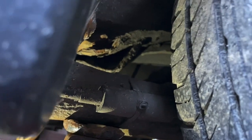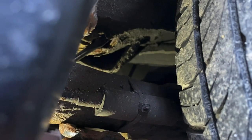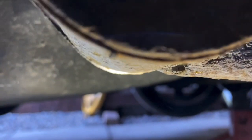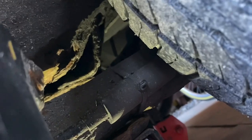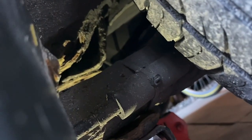And also I found — where I'm pointing with the screwdriver here — that bit needs welding. I'm going to have to take out the fuel tank for that. There's the fuel tank, there's the rear axle bolts, and it is just above there. The fuel tank's just behind there. So I'll drop the axle, remove the fuel tank and sort all that out. I'll have a really good look around the Fiesta under there while I'm doing all this work. Like I say, as long as it's back on the road by April, I'm not too bothered — it's weather dependent at the moment.